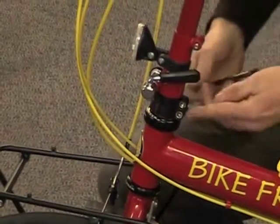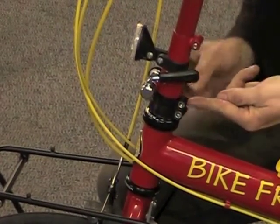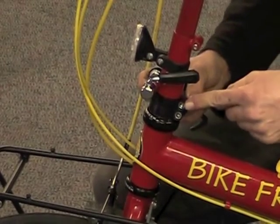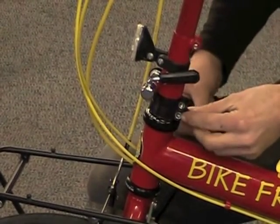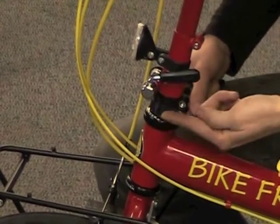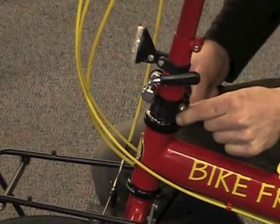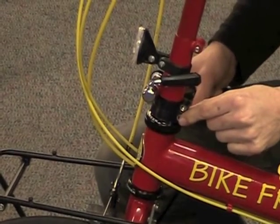I also want to point out that right above this expanding spacer, there's a clamp. This is a fixed clamp — it should not be adjusted. This adjusting spacer presses down on the bearing cups and pushes up against the fixed clamp. So as long as this one is properly tight, the preload adjuster can do its job.